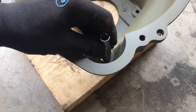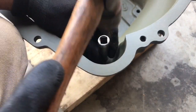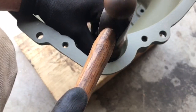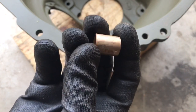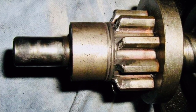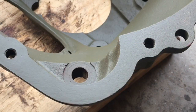To remove the bushing, I found a socket that's the same diameter as the inner side of the bushing. I'll just insert it here and give it a few taps with my soft-face hammer, and the bushing will come right out the front side of the bell housing. You can see here that it's oblong and shows some signs of wear. This bushing is important because it keeps the shaft, and inevitably the gear teeth on the starter, aligned with the gear teeth on the flywheel. Movement in this area can cause the teeth not to mesh and cause you starting problems.